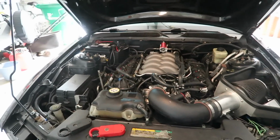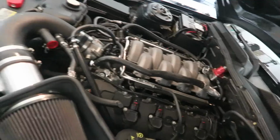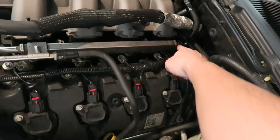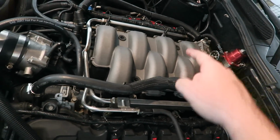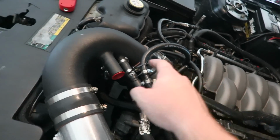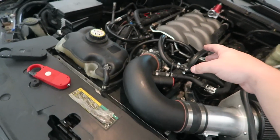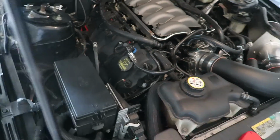Okay, so I wanted to do a little recap of everything I did. So basically, first take the cold air off, then your fuel rails, unplug this. There are 2 bolts connected to your fuel rail, get those off over there as well. Then take that off, unplug, there are going to be 3 hoses, 1, 2, 3, take those off real quick. Then after that, unplug this, and you should be ready to go to take everything off.